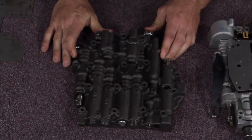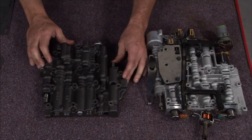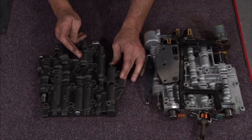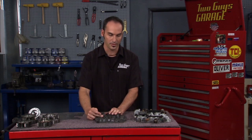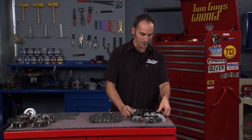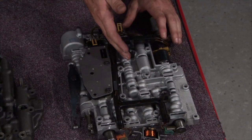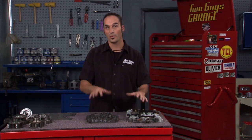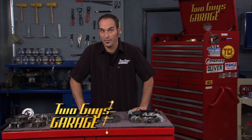You can see these valve bodies actually look pretty similar — this one's all mechanical, this one's got electronics. Here's my TV cable: as that cable pushes, I build up pressure to shift from first to second, then build up more pressure for second to third. In the electronic version, I've got solenoids doing a lot of that work. Because I've got a brain, I can tell which solenoid what to do for each shift. We picked Monster because they know how to build these beefy. We've got a good solid motor, we want a strong trans.